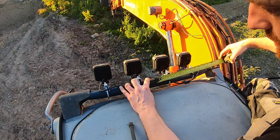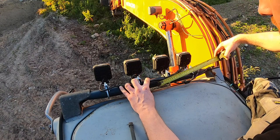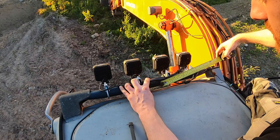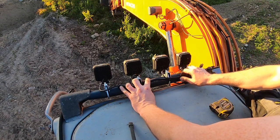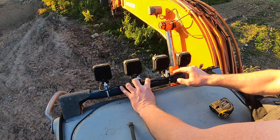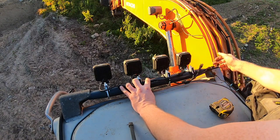I'm probably going to go up to the front to leave the extra little bit on the cables whenever I cut them. From there to the beginning of the next one is 130 millimeters or 5 inches. So they're all going to be 5 inches apart right across. So I'm going to have four plugs 5 inches apart on the loom. So this will be your end of loom, and then you'll have 1, 2, 3.